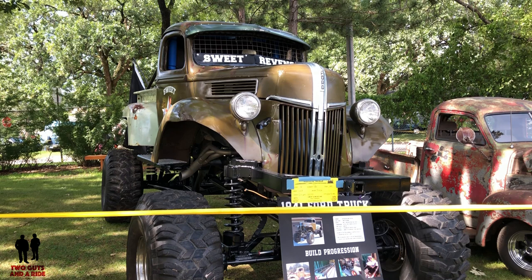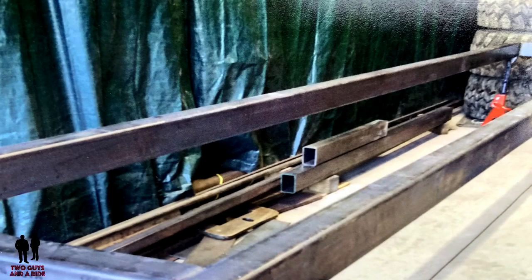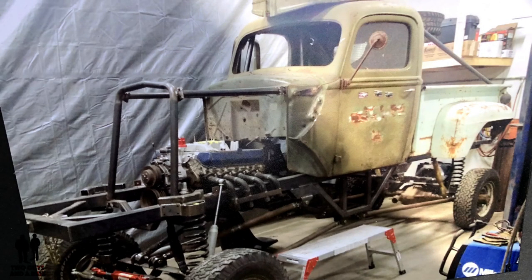How did you do the frame? The frame started off as three by four square steel, three sixteenths thick. I just started off, squared it off, made a rectangle out of it. And that's where I started.